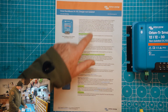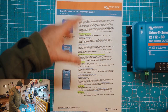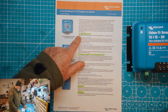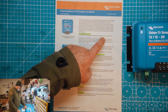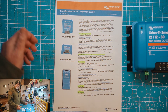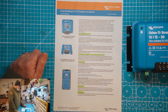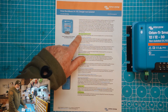This is a non-isolated unit, similar to the 30 amp in that it has three terminals. One feature I really like is the adjustable charging current. The charge current is adjustable with a minimum step size of 0.1 amp via Victron Connect — that's the app. You Bluetooth to it and tell it, for example, your alternator isn't big enough for all 50 amps so you only want to charge at 40. You could even drop it down to around 5 amps for charging through a caravan plug. Being able to adjust the charge current between 1 and 50 amps is a huge plus.